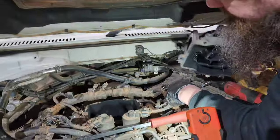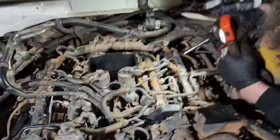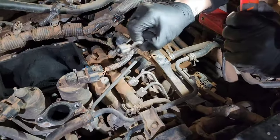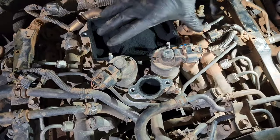We've got the manifold off and we have to get down in underneath here. This whole manifold section here has got to come out. We'll remove these rails, which means you've got to take the lines off the injectors. The EGR stuff can stay there, but this should be able to lift out from under it — these are what's holding it on.